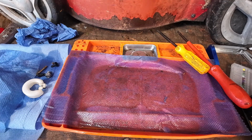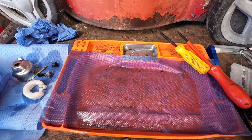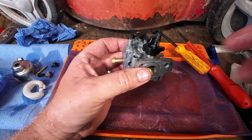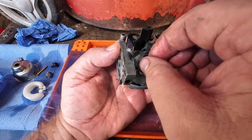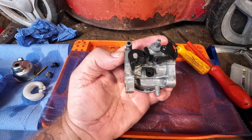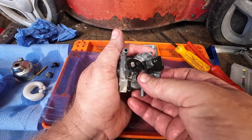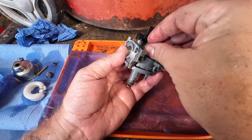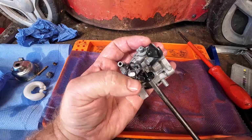I'm going to reinstate the carburetor assembly back together very quickly for you. I've only been doing that for about 3 minutes or so. So everything needs to be clean, guys, right? We're going to put the slow idle circuit jet back in first. Now that only goes one of two ways. It goes in flat side like that, okay? It does not go like that, right? It's got to go around that way like that. Once it's in, push that down. Grab a little tiny screw. That goes in. Do that up till you've got about 2 or 3 threads hanging out the back of the other side.